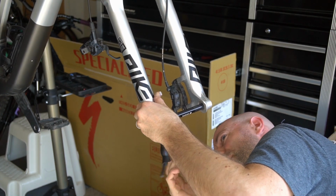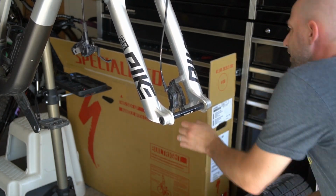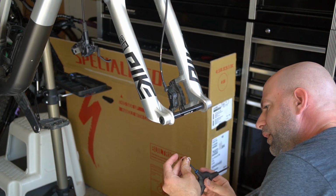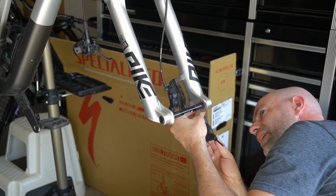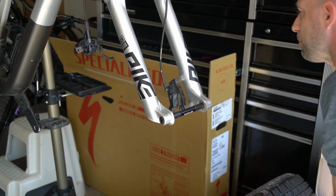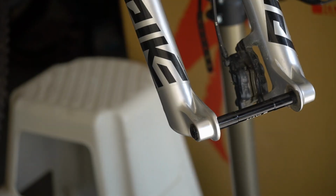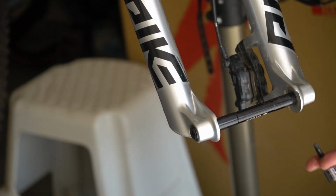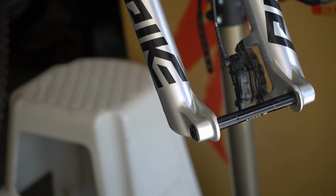Taking the other bolt out a little bit, not all the way, and I believe, if I'm not mistaken, that we actually want to keep this bolt in slightly. And I think we want to give it a little tap from the underside to loosen it up. Basically, I took this other bit, put it up underneath here with the bolt still in place. That allowed me to give it a good little smack, and that loosened the seal underneath, and the fluid was able to start draining out.